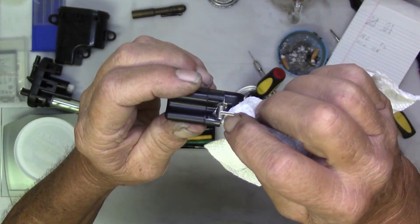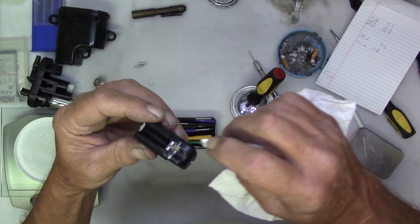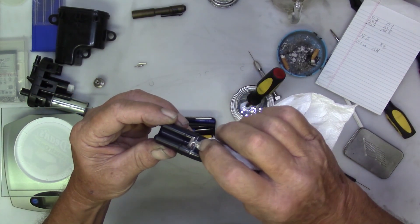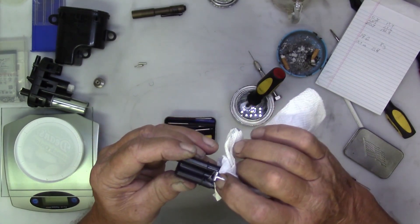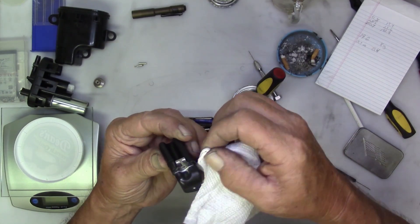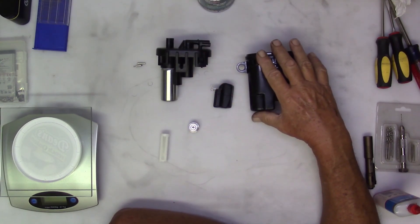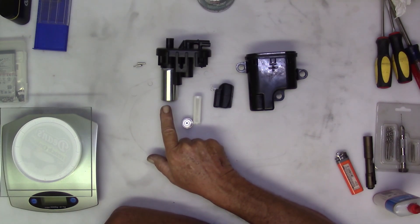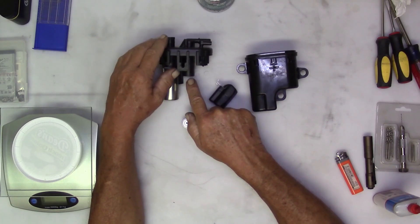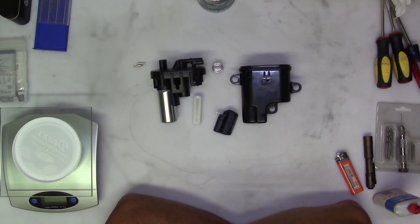I screw the tiny screw into the hole and apply the Por-15. This stuff requires 96 hours to dry, but I'm hoping that because it's so thin, by tomorrow morning it should be dry enough to use. Tomorrow's Sunday and I've got to have it ready by Monday. You can see just that tiny bit I've got on there — it's flowing all over the place. There's not much to this pump: just the pump, the float, a check valve, the filter. Gas gets pumped in, comes into the chamber, through the filter, and out.